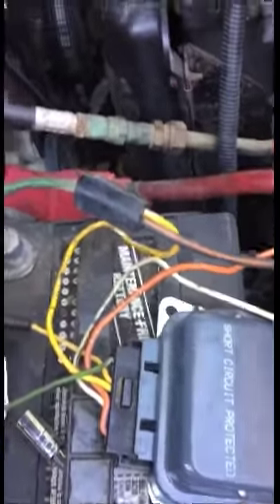Now it's time to wire up the mega fuse. We've got a four-gauge wire from the power terminal on the alternator. Everything looks great - bolted in nice and tight, mega fuse wired back to the original power terminal. Starting up the truck - no battery light! Needle's climbing, truck's still warming up - looks great.